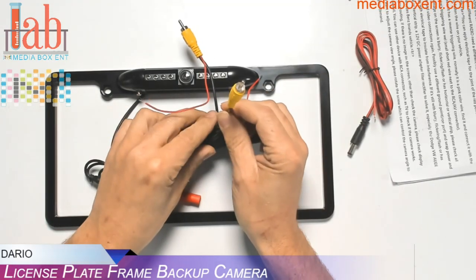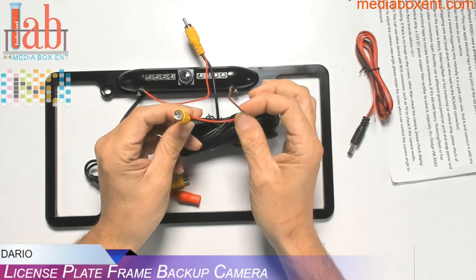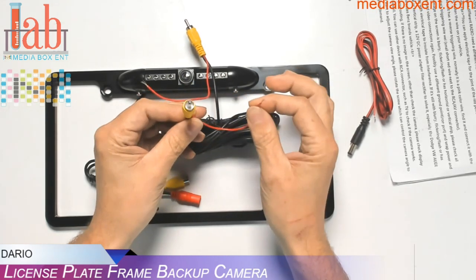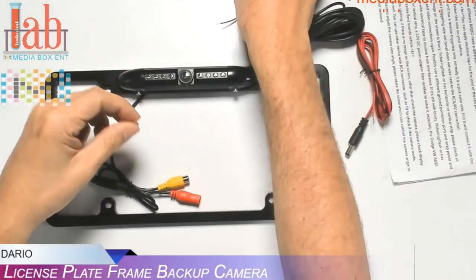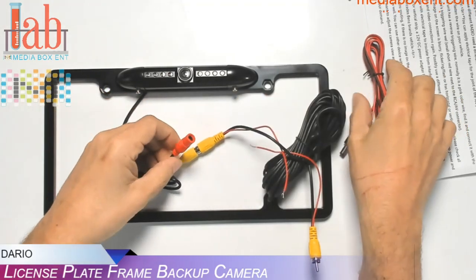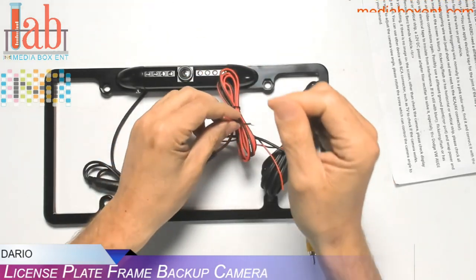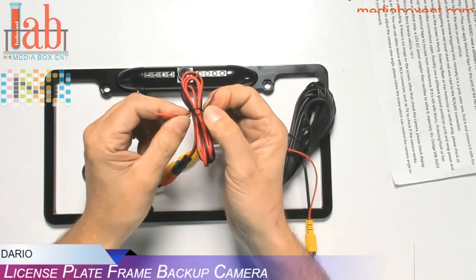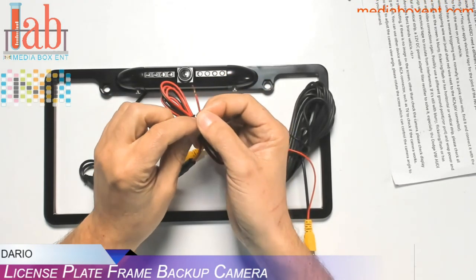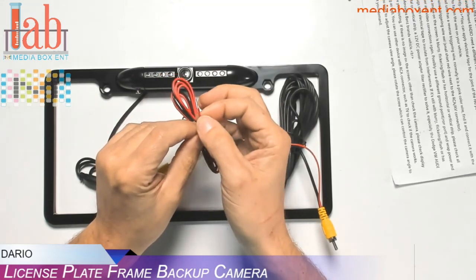You're going to put the power right into your stereo. The red wire is for your trigger wire — some stereos have a pink-colored wire, so you want to hook this up to that stereo wire. On the other side, you hook this up to the plug. To power the camera, hook this into your reverse light. Put the ground wire into the chassis, and the plus wire goes into your reverse light. Use a tester or some type of device to check and make sure you're connected to the reverse light.